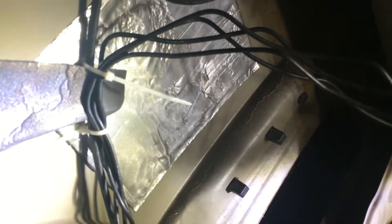These sensors are put in here and they're looking good. We ran them through the bottom, pulled them up to the top. Here's our access panel right here — took it through here and ran it up through here, tied it to the cable so it stays away from stuff and doesn't get pulled back down. I want to keep it up in the actual compartment and not let it shake down into the bottom part of the bumper, so this should hold it in place.